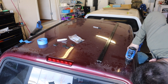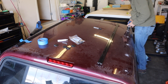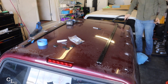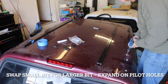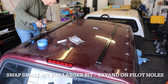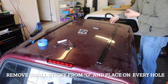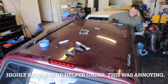Do the same thing on the other side. Right after drilling, vacuum up all the debris to keep the workspace clean. Once the pilot holes are done, switch to the next size drill bit from the set and expand each pilot hole. The reason for doing it in two steps is to avoid cracking your fiberglass. Then remove the sticky backing from the O-rings and apply one to every hole under the track. After that, apply silicone to the holes and put the screws in.